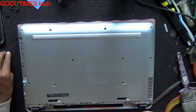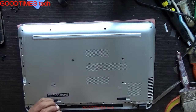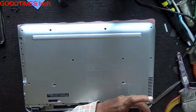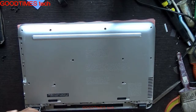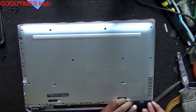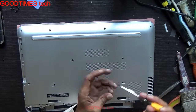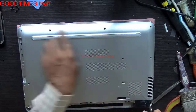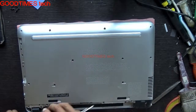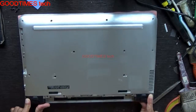I will show you where to insert the lengthy screws last. There are also keyboard screws — two screws come here and two screws come here. These are the foot copper base feet. Lock them by pressing. These two lengthy screws will be fastened here — they fit exactly at these two corners. If you put them anywhere else, they will protrude out through the front touch pad panel. So keep in mind that these two lengthy screws are to be mounted only at these two corners.